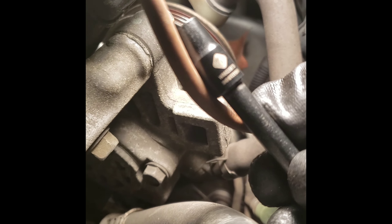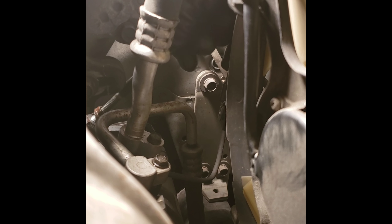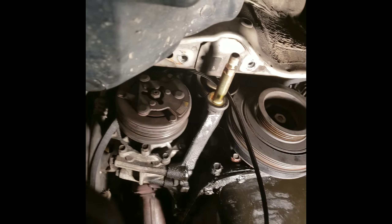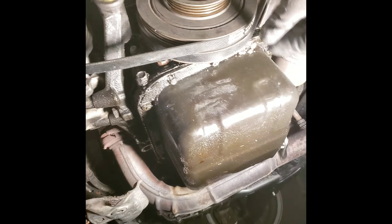Now the more you back this down, the lower the pulley will go. Once the nut is cracked loose, you really can just back this out by hand — it is not that tight. Now that you have backed out that small bolt, you can slip your AC belt over top of the middle pulley and around your AC clutch and around your harmonic balancer. It should go on fairly easy since you have loosened that pulley.